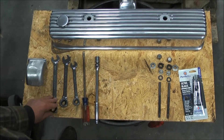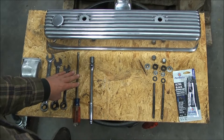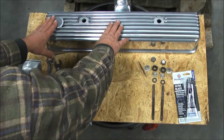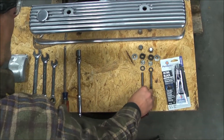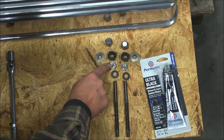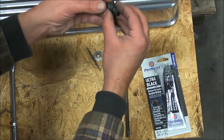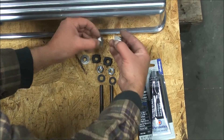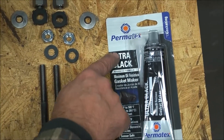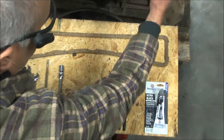Tools that are going to be needed: a 3/4-inch wrench, 11/16ths, a 9/16ths wrench, a straight screwdriver, and you may need a 7/16ths socket. This is a 9/16ths socket on a 3/8ths drive. You're going to need a valve cover, of course. Then over here you're going to need a stud kit — I do offer that — which has two proper-length studs, two steel washers, two heavy nuts, two sealed washers. These grommets actually come with the valve cover gasket kit, but you'll need the grommets, and then these acorn nuts that go on top for decoration. I like to use Permatex Ultra Black — and that's the key words: ultra black, not just black. This is really good to help you seal down, and of course you'll need a gasket.